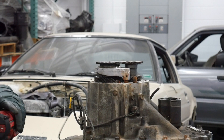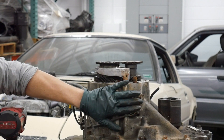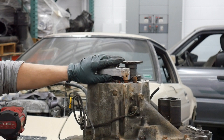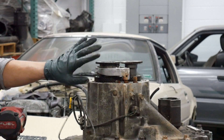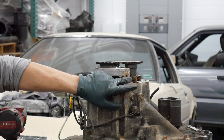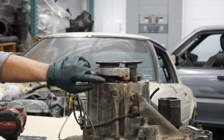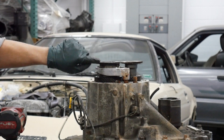For the purpose of this part of the video, I've flipped the transmission on its side — this is essentially the bottom of the transmission, what you'd be looking at. The first thing you want to do once you get this pan off is spray some brake clean and clean all this off, then take a punch and drive this roll pin toward the top of your vehicle — or just drive it away from what you can see.